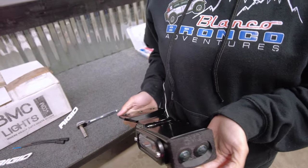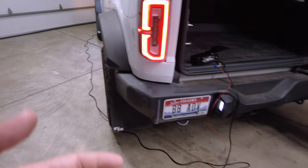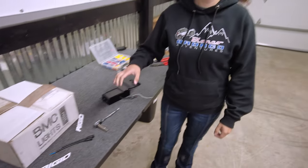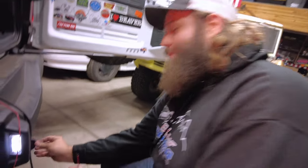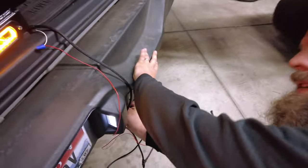We've been playing around — we laid the wire out all along the Bronco trying to figure out how to wire these. Our box didn't come with any instructions, so we're literally just winging it. With the key on, we were just poking a wire around in the trailer hitch connector and figured some things out. The white wire coming off the light — if you want it to be a runner light, just put it on your runner light pin.